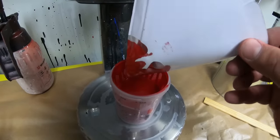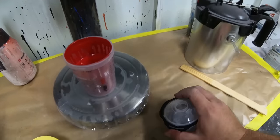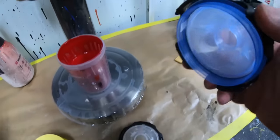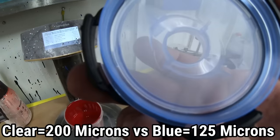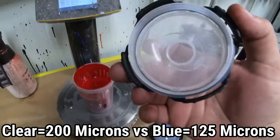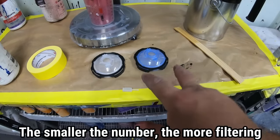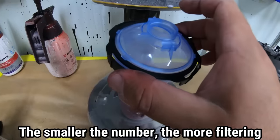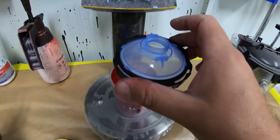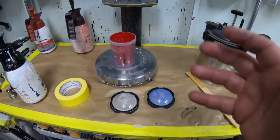But there's one more line of defense: our PPS cup lids. There are two different types — one for water base and one for solvent. The water base has a tighter mesh so it will filter even better, while the solvent base has a slightly looser wire mesh. Between these two, you can use one if you feel you need a little extra protection, and I don't see any effect of it slowing paint flow through the gun.